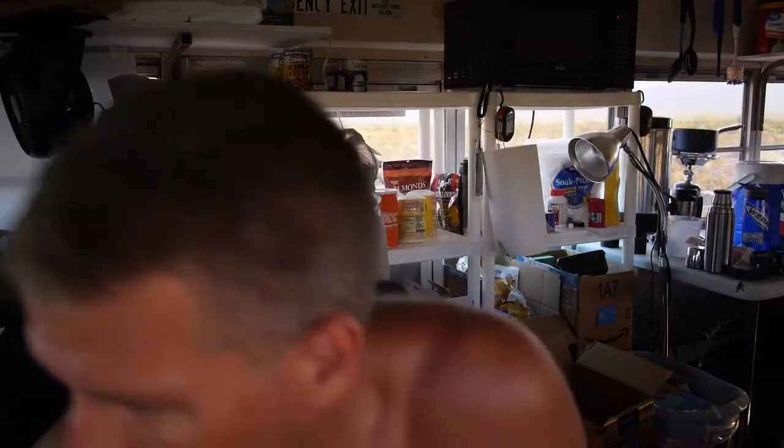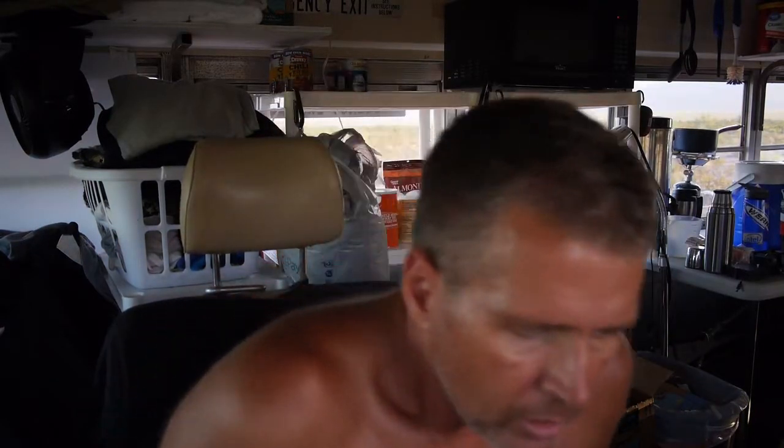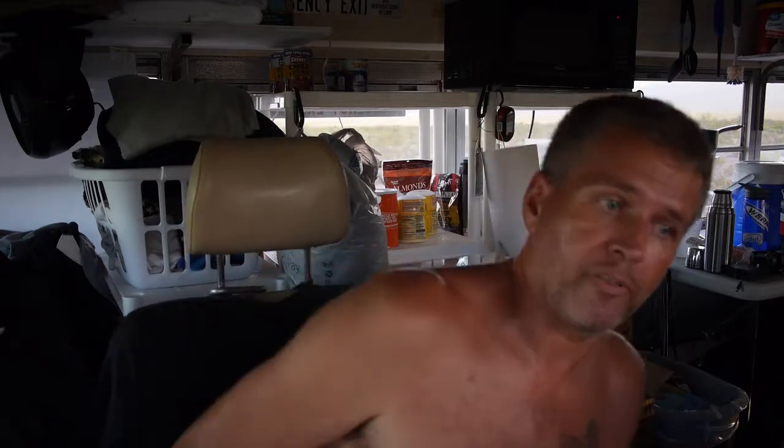The other option is an arched roof like a school bus. Since I'm living in a school bus I have firsthand experience. The bus interior is 80 inches wide and I'm only about a foot narrower on the camper platform. If I copy the same curvature but compress it, I get a little over a six-foot ceiling in the center, dropping nine inches at the outer edge. I think if you parked them side by side you'd see the similarity, which would be kind of fun.